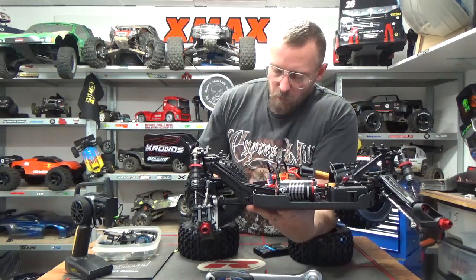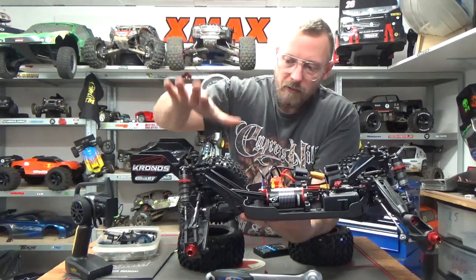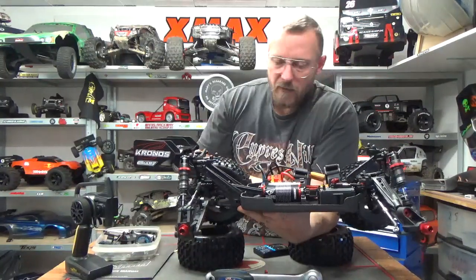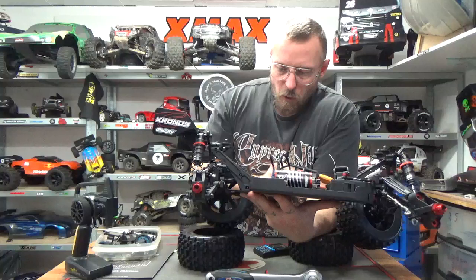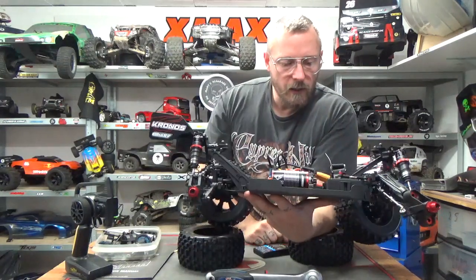At the beginning it should be 7075 T6 alloy chassis and shock towers. That's no more the case, because it was too costly for them, so they go back to 6061, 5 mm in the rear, 4 in the front. I think they also have to do 5 in the front. Chassis 3 mm, but with this cool reinforcement bar I think it will be okay.